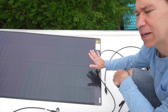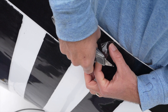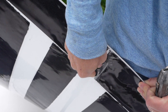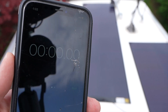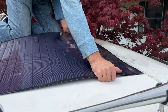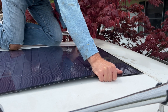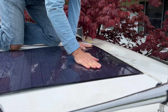For the solar panels where I'm going to put the junction box on the end, because it has the adhesive strip all the way across, I'm going to cut a little channel — sort of like a weep hole — just in case there's any moisture or liquid that gets in there, so it'll have a chance to get out. I first tried the technique of peeling off a little bit on the edge first to get it aligned right, because once you lay this adhesive down, it's so sticky it's not going to move, so you kind of get one shot.